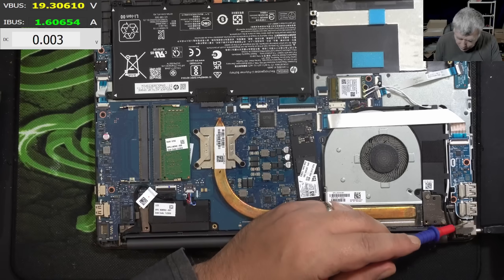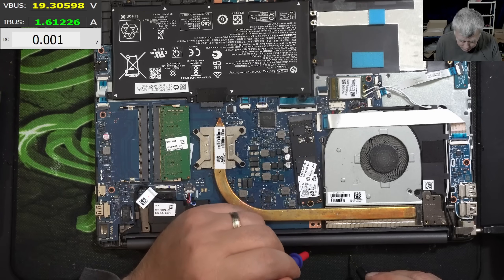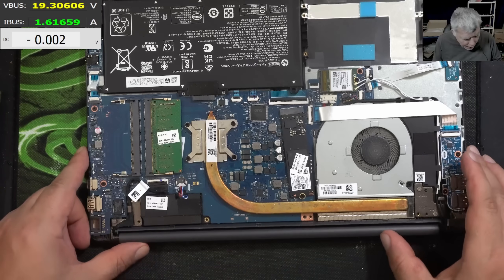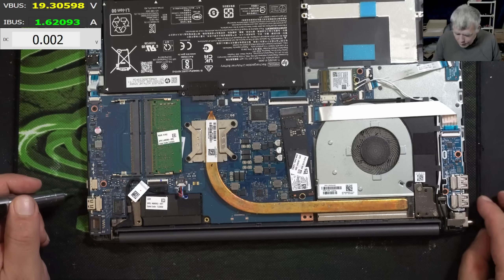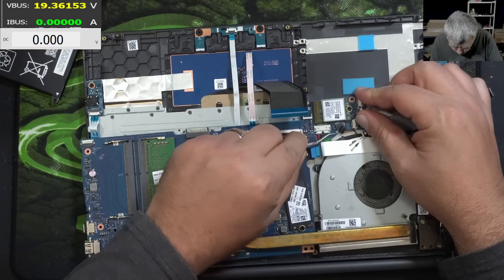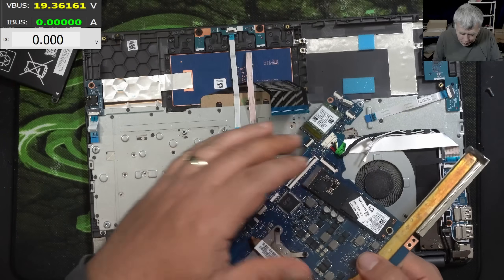The charging port is here. We're looking for the input circuit, the first MOSFET, the second MOSFET. I'm not happy with 18.6V — I need to know why. Just give me a few minutes. The motherboard is out, with the charging cable left there.